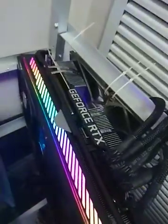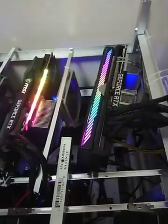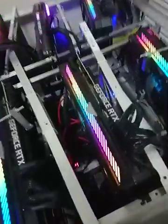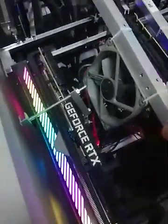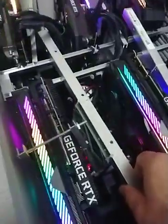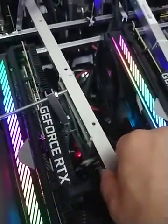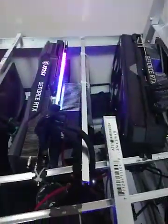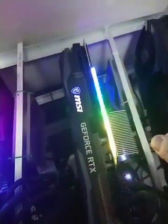Okay, so it's working now. There are also two fans pointing at the backplate on this one; the rest have one fan each. I purchased another seven fans — I want each card to have two fans. By the way, if you wonder how to mount a fan quickly: you just hang it like this on the frame — see the fan there — and you can move it closer or farther from the GPU. A very easy way to install a fan without mounting it directly to the backplate.